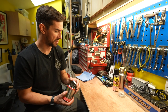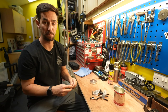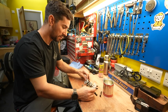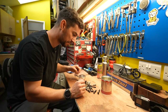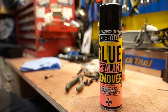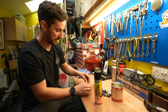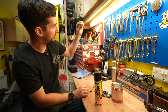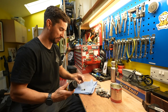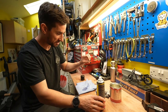While we're on the tubeless topic — here are some of my old valves. You might find older valves get full of sealant eventually. If you pump up your tire and it feels like you have to push really hard to get any air in, or if you're letting out air and it just comes out really slowly, what you need to do is clean them out. If you unscrew the end and look inside, you can see it's kind of gunked up — almost full. So the airflow is really reduced. Spraying some solvent or glue-and-sealant remover in there will help, but it doesn't always do the whole job.